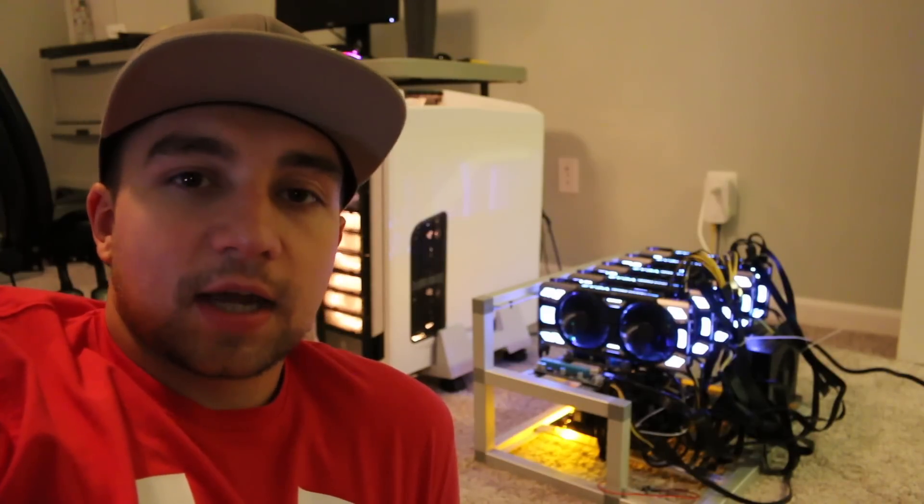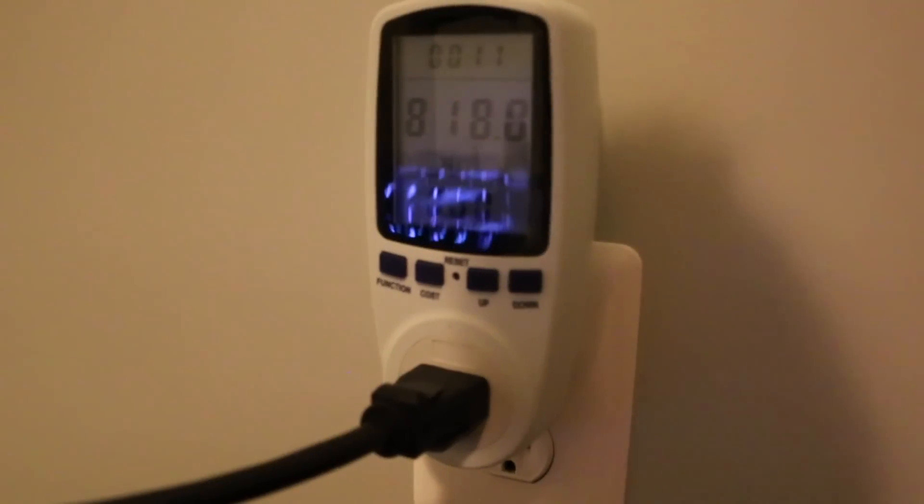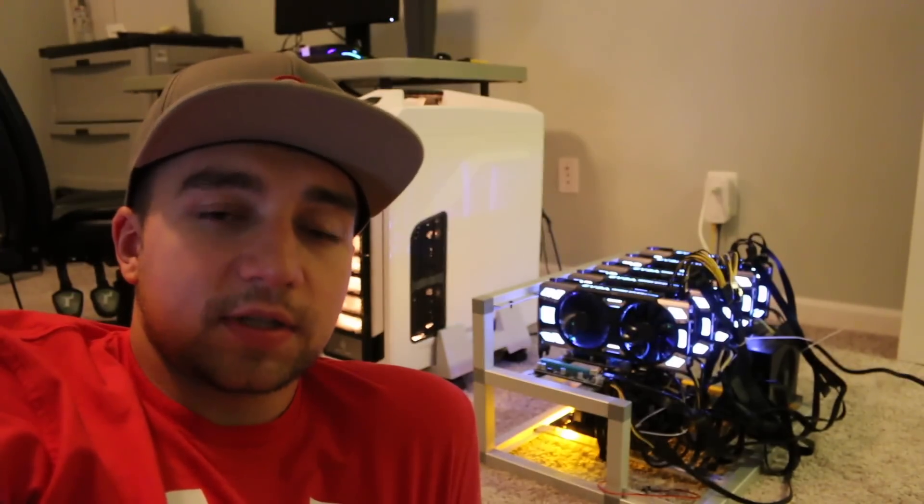We are up and mining away. We're using Simple Mining which has detected the 1070 Ti's — it's not telling us the card name but it detects a NVIDIA card, which is all it really needs. We've set the power limit, memory, and core values. Right now we're running plus 200 core, plus 700 memory, and 120 watts power limit — that's our baseline from Windows adjusted for Linux. The kilowatt meter is pulling about 820 watts. Using these settings on EWBF we're getting a stable 500 sols on each card at 120 watts. Using the DSTM miner that number would be a bit higher but it hasn't been implemented into Simple Mining yet.